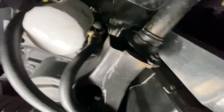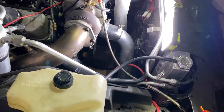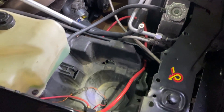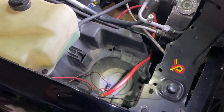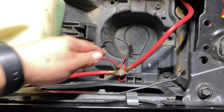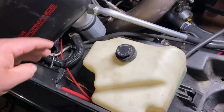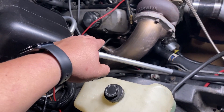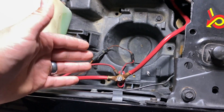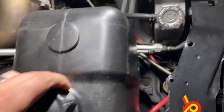Lucky for me the battery had been relocated before I got it. Here's where the methanol tank is going to go — I'm going to try to move the Snow Performance kit that I have on the '87 to this one. This is the tank I'm going to use. I'll have to move this stud they put here, and it'll probably end up going on the inside so the wire can run up and around. I also have to extend all the positive leads since I have to run wires to the battery, and then the only wire I have to worry about is the alternator.